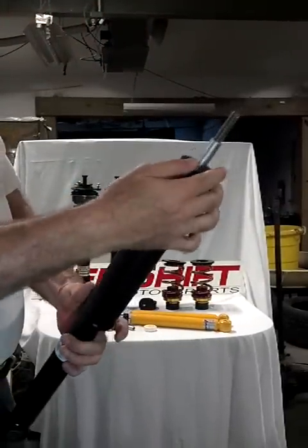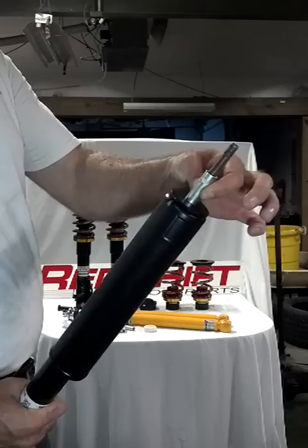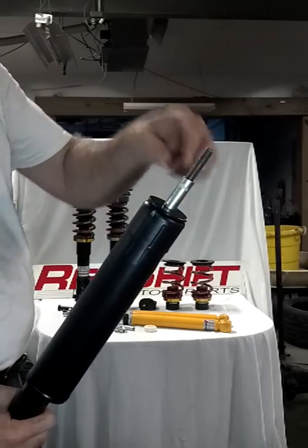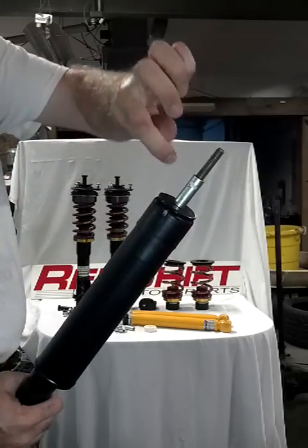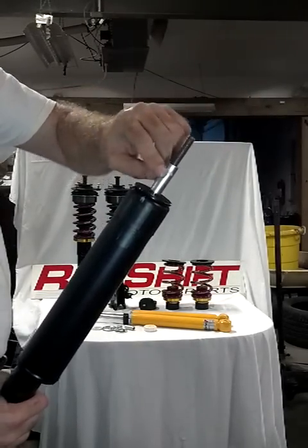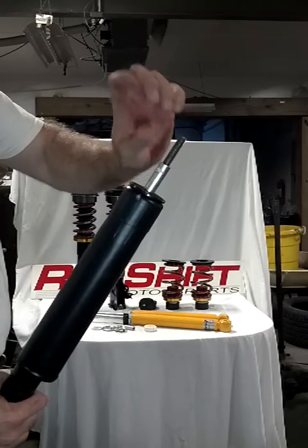What you have to do — and the reason this is a little bit difficult — is you have to drill out two things. One is this little sleeve here; this doesn't come off. It's held in place by this little dimple, this little peen thing. The inside of the sleeve has a protrusion on it, so this doesn't come off. What you have to do is drill that little circle out. Try not to go crazy and drill through the piston — if you nick this a little bit, it's not a big deal.